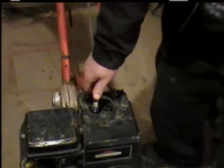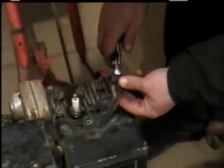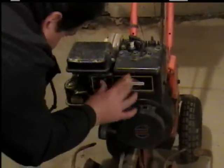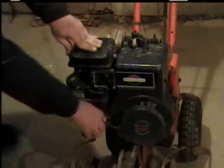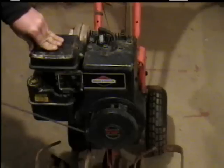Then put the plug wire back on it. Sometimes I don't know if it's got a spring in there or a little clip — round like this. You might need to take your pliers, squeeze it together a little bit, make it stay on better. Make sure that's good and tight. Push it on until you hear a click, and there you go — the motor should be ready to start. What you got to remember, this motor actually has to suck the gas up first. It worked! There you go. Thanks for watching.